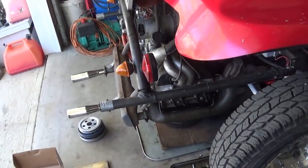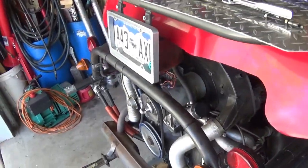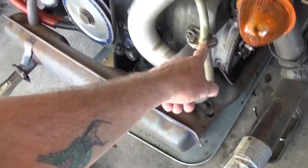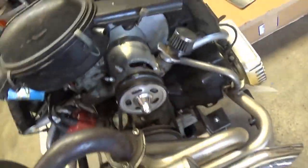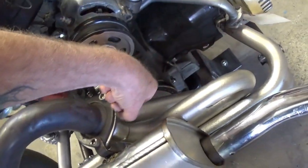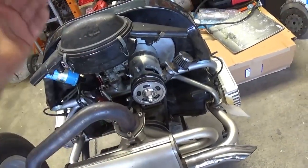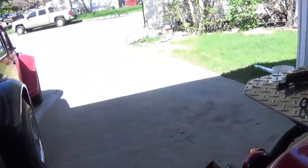What's the next step in this project? I plan on experimenting with this manifold because of all the heat it provides. However, a header system that crosses from side to side doesn't give you as much heat across the intake manifold. This carburetor lacks heat — it gets some, but not enough compared to the stock setup. You could fabricate something and route it into the collector somehow, but I can't find the right material to do it on my own.